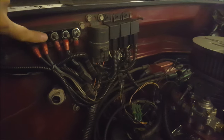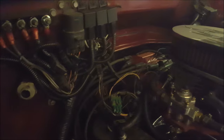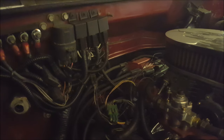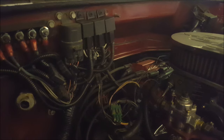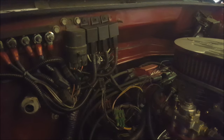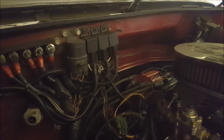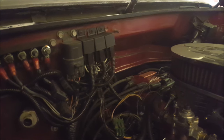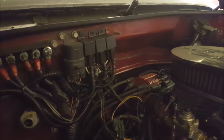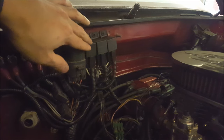On some of these, they will actually go to accessory and then we drive it off a relay. The reason why we want to drive it off a relay is the relay can handle more amperage than running on a switch. I do not recommend a manual switch — I would run this with ignition. I've seen some people run other devices off a switch and run a lot of current through it, and that's not a great idea. Even if the switch can handle it, I just don't like having high current run where you don't need to. So we're going to let the relays take the brunt of the force.